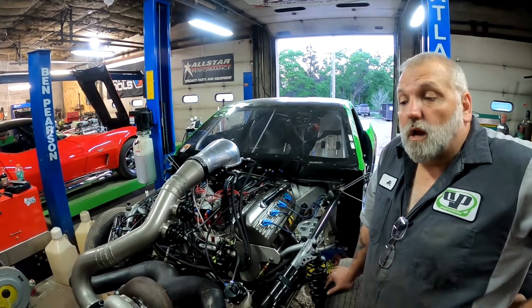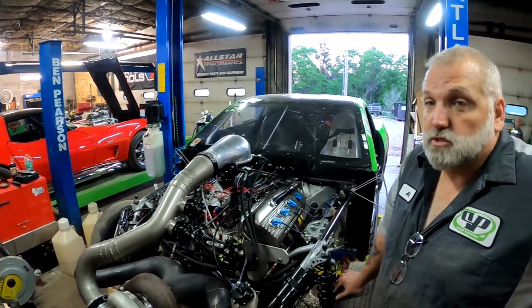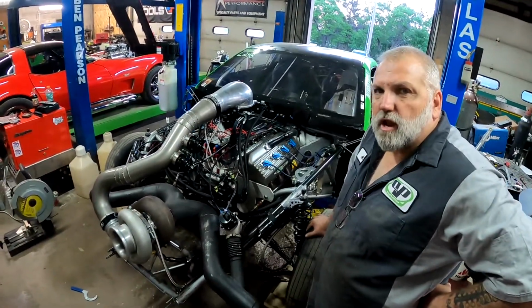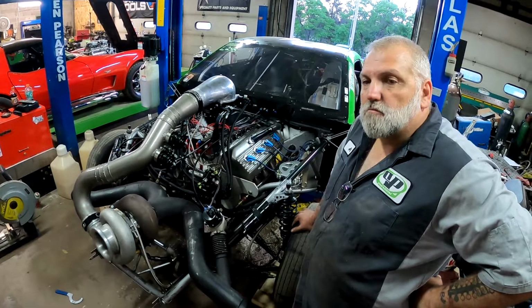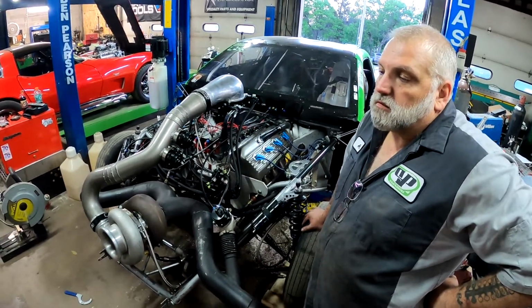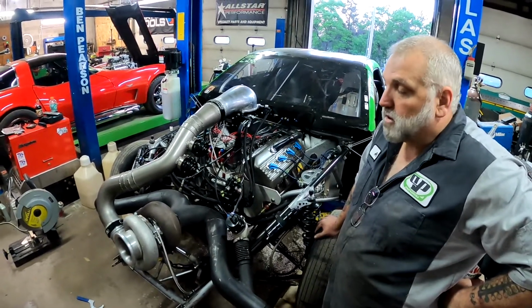No, I can say. Real simply, because the track is not going to be prepped as it was in Georgia, we aren't going to have as sticky of a track. It's going to be a marginal track. I'm giving it a little bit more front-end travel than what we had in Georgia. Okay. That'll just help promote weight transfer and get it down the track. Cool.